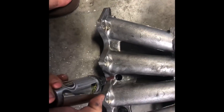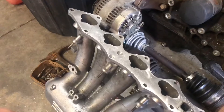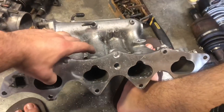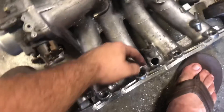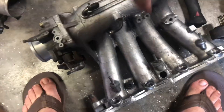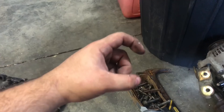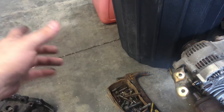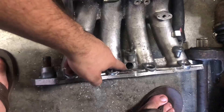Let's start on the bottom of the manifold. I cleaned up the bore for the stud that comes off the manifold, so it's going to slide in and out perfectly now. However, being that it's only a sanding disc and not an actual porting bit, it's not going to clean up exactly how I want it. I ordered carbide burrs — the actual tool used for porting cylinder heads — like 10 bits online, and they should come in a couple of days. Then I'll be able to clean that up, make it flat, and get it to the right depth to fit the necessary hardware.